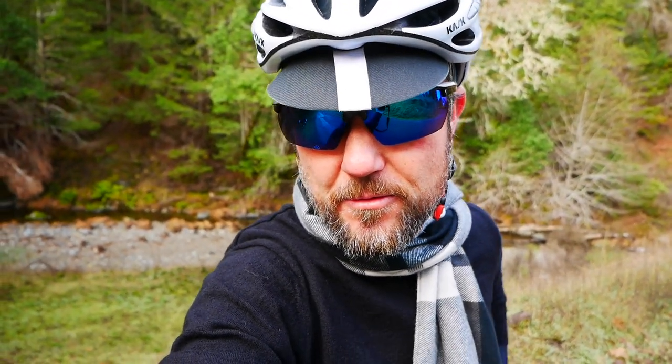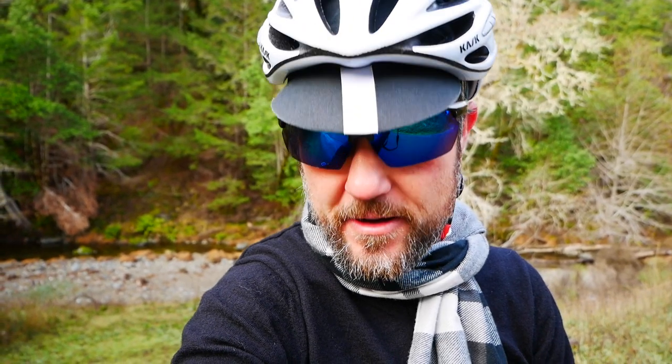So on the front tire, this is the front tire because, as you recall, I have replaced the rear tire. The rear tire was replaced about 2,500 miles in, and I explained why I didn't put the new tire on the front: the rear tire is the standard casing and the front is the extra light. My theory was that if you put the extra light on the back and the stiffer wall on the front, you're going to change the general ride characteristic. And I didn't want to do that.